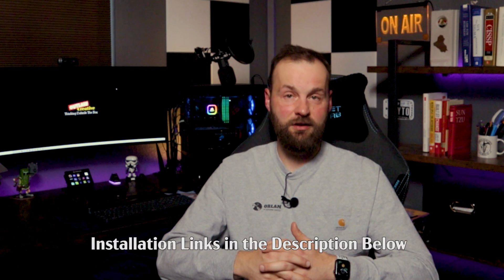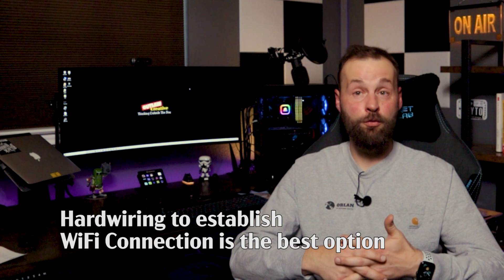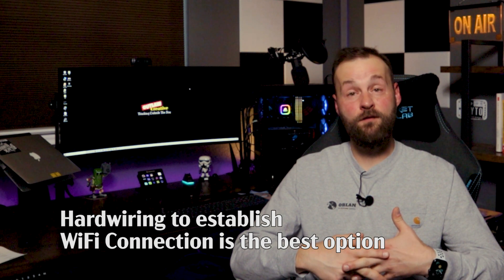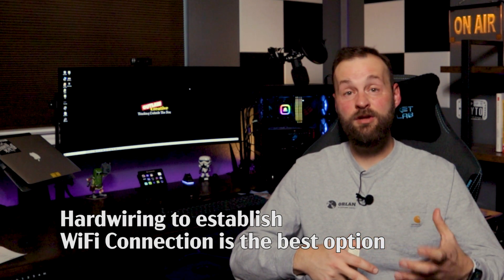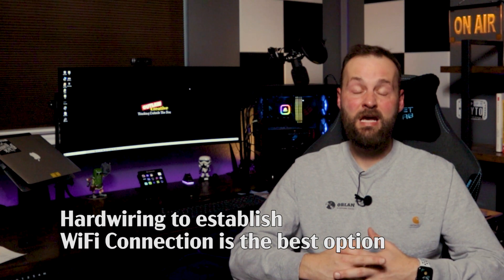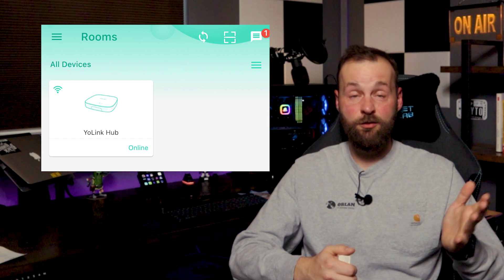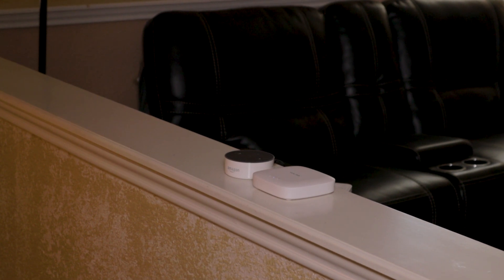At the time of this review, it works only on 2.4 GHz Wi-Fi and will not work on 5 GHz, so if you only have 5 GHz Wi-Fi, hardwiring is your easiest and fastest solution. YoLink has several extended manuals on their website covering multiple connection methods. I highly recommend setting up Wi-Fi by first hardwiring the hub for configuration, then disconnecting the ethernet cable once the connection is established. I tried connecting via the app and due to 5 GHz interference it wasn't working, but as soon as I hardwired it, it connected instantly.